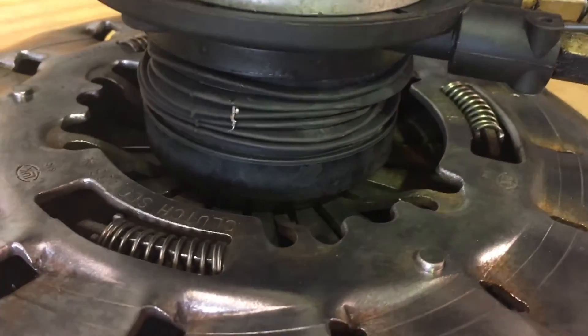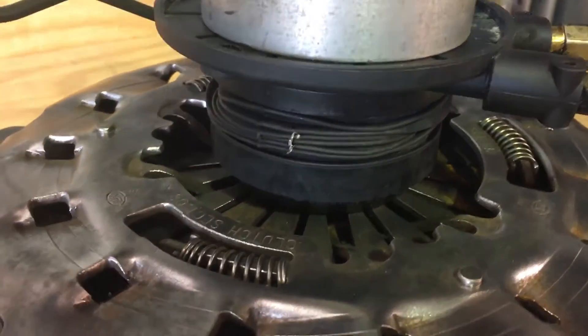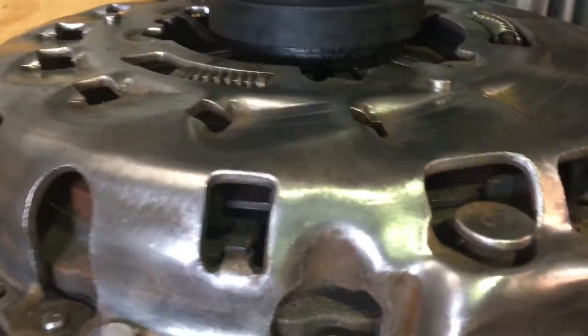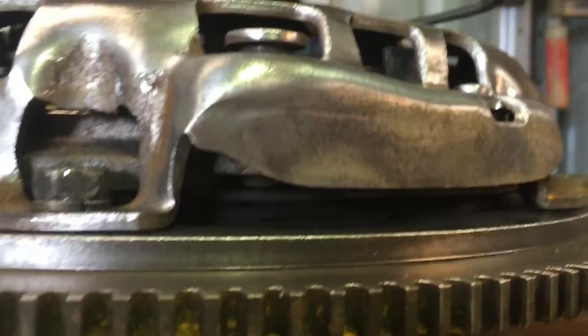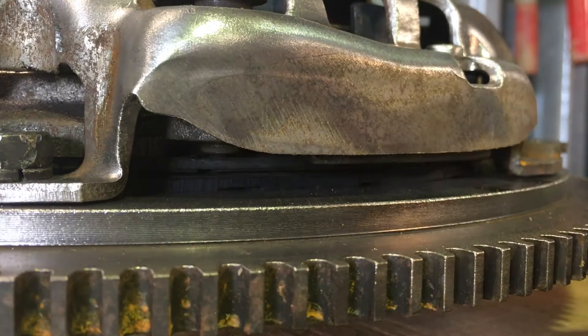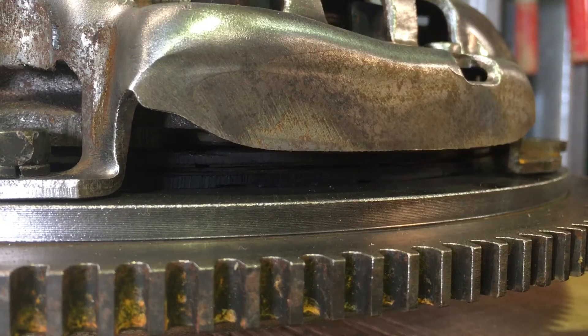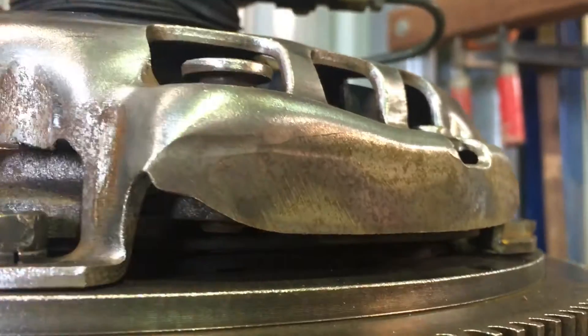You can see them go down and up. If I bring the camera down here and try and show you the internals, we can actually see it work with the pressure plate on the actual clutch itself. As I press the pedal, you can see the pressure plate lifts, which actually releases the clutch inside. If I release it, you can see it doing the opposite.